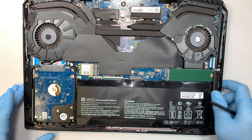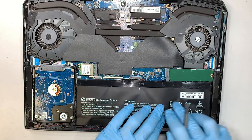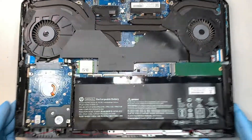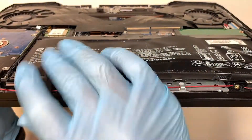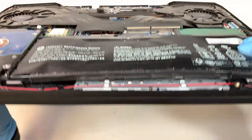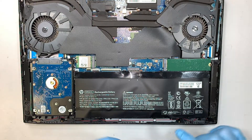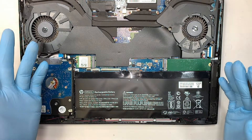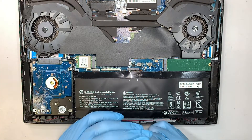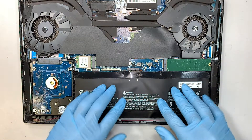This is the first time I'm looking at this model, and I noticed that the battery is swollen. You can see there are lumps on the battery — the first and the third are more obvious, the second and fourth are not so bad. This computer was checked in this morning by a customer who told me the battery is not holding charge at all — it's fully charged but only lasts about 40 minutes before the computer dies.